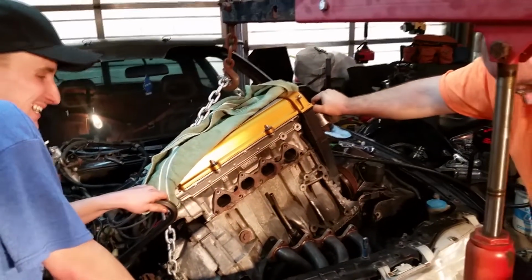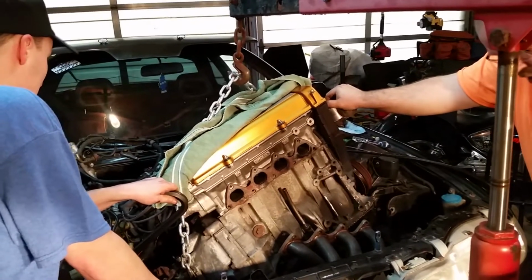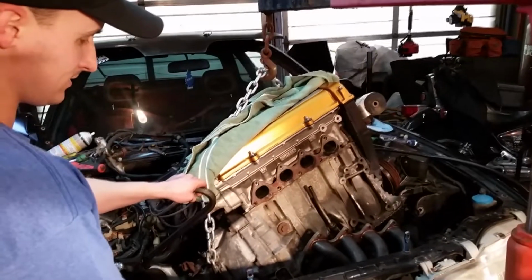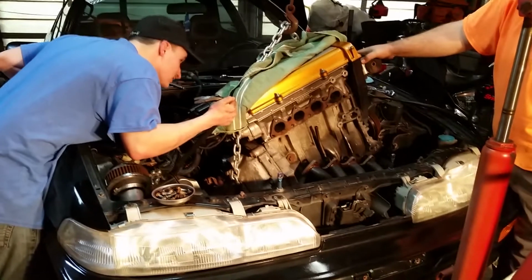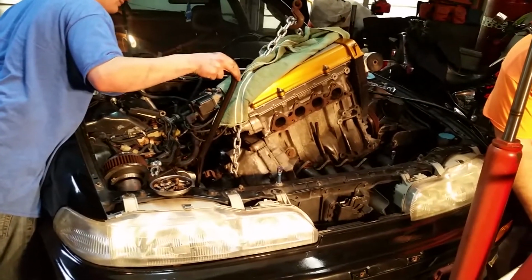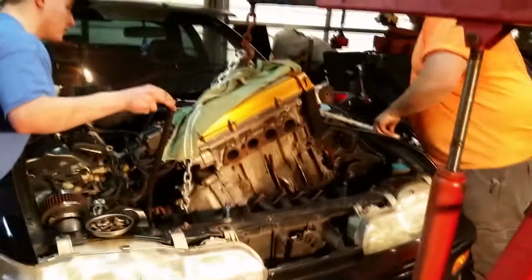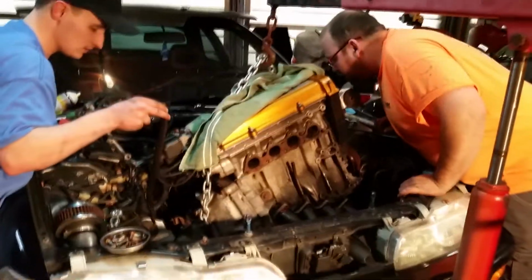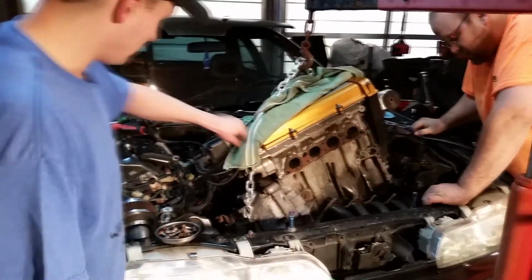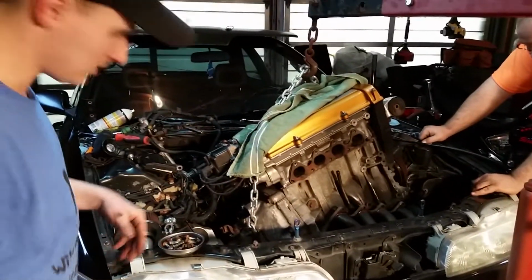Come on, Sammy. Oh, wait, we're lifting the car. Oh! We're lifting the car. Don't move. Houston, we have a problem. Watch your fingers. I'm clear. Now wait. The exhaust just fell. The back bracket is resting right on the master cylinder. Look. I don't remember this being this hard last time. That's probably because I removed the exhaust, though. If we remove the exhaust, we can swing the whole thing forward and get it out.